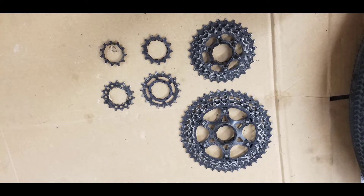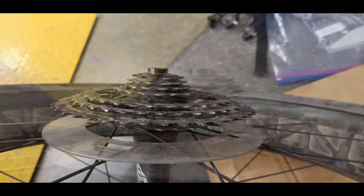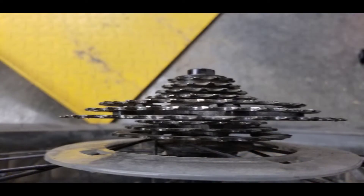The first thing I did was to dismantle the 10-speed cassette to see exactly which chunks it might break down into. This is a Sunrace cassette and it resulted in two sections of three gears and four individual smaller gears. I decided to put the smaller group of three cogs in first to give some better spacing to the big gear — the 42-tooth — which is the one I really wanted to be in the best position.